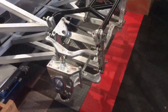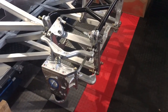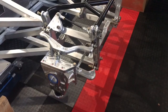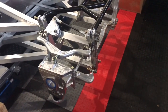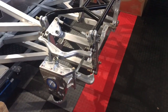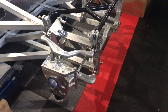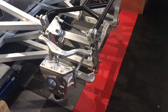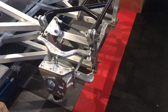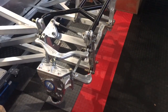The anti-droop rods are installed on the rear suspension and it all came out great. The rear suspension is hanging at 18.75 inches off the ground and the front at 19.5 inches. The difference compensates for the taller rear tires and also the fact that the chassis angles slightly down toward the floor at the rear, so the chassis-to-ground distance is different front and back. In the next video we'll cover installing the wheel bearings, putting the wheels on, and hopefully getting the body mounted to see how this initial alignment looks.